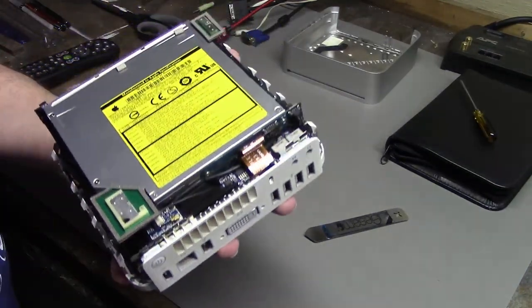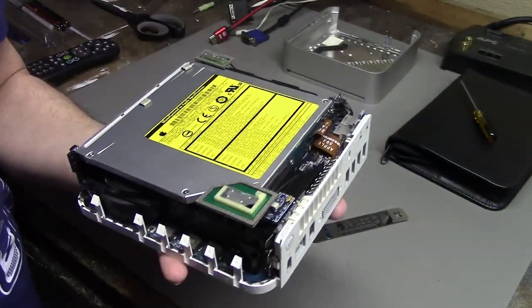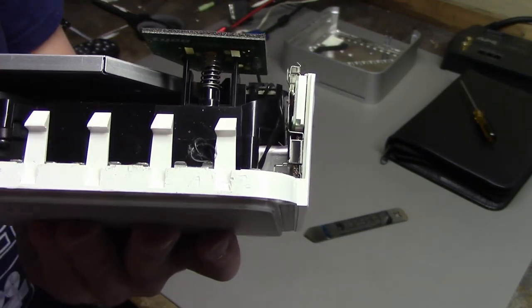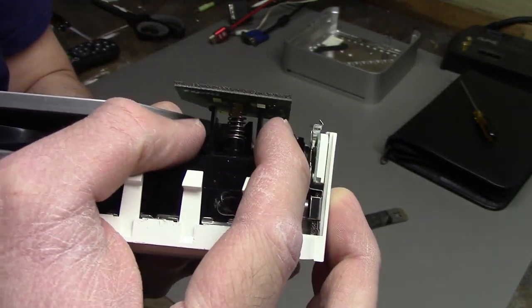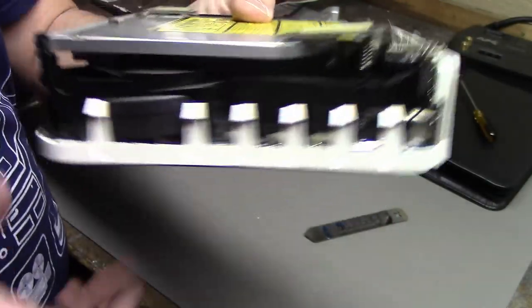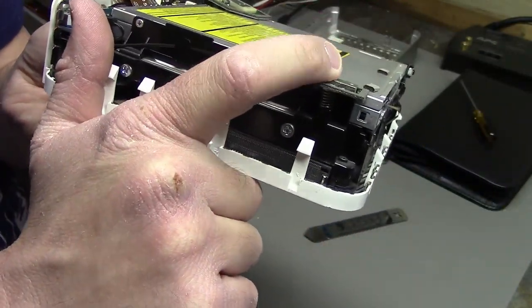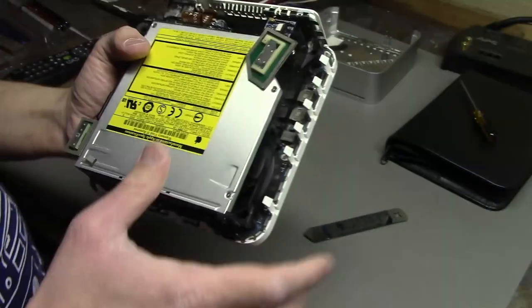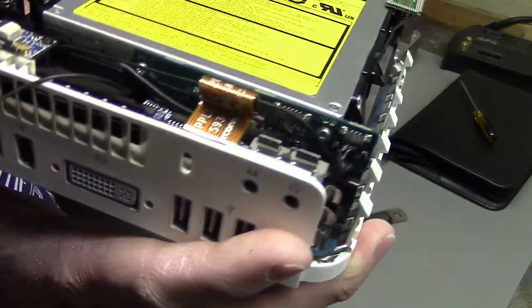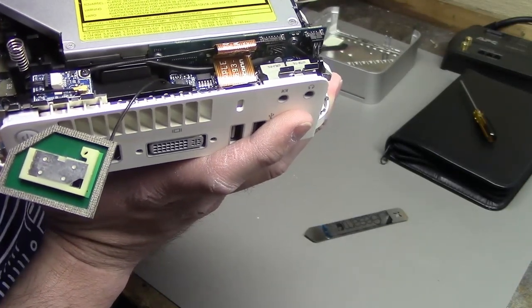Okay, so taking the thing apart is gonna be fun. There's tons of little, like, teeny connectors and little tiny things. So, first thing to open this up, we have this Wi-Fi antenna here, which we have to get off. You can see it's held on with these two little plastic clips, not the spring, the little clips on the sides. So you squeeze those in, and then this should just come off like that. It's a little weird that the Wi-Fi antenna is on a spring. See the other one on this side here, the Wi-Fi antenna right here is also on a spring. A little weird. So with the Wi-Fi antenna off, put that to the side, and now we have to try to get the CD-ROM connector off from the back of the CD-ROM drive there. That's gonna be fun to get to.